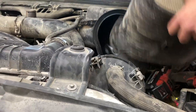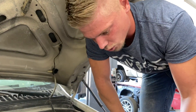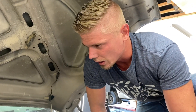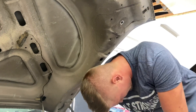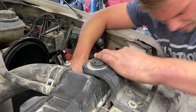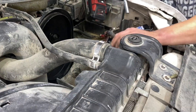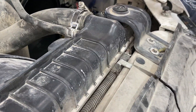The main things we have to disconnect are the radiator cooling lines, intercooler lines, and a couple small things like the power steering. I think everything comes up with the cab besides the frame wiring. Looks like an 18 down in the hole — that's not good. It was blue, which is good for us, but we never checked it before.